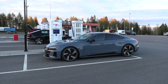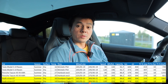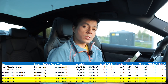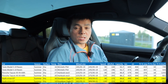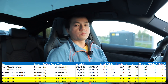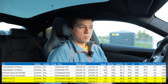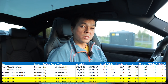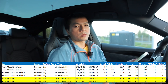We are back again charging, and the result for this time is that — actually to my big surprise — we only consumed 224 Wh/km, with an average of 14 degrees. That means we have 378 kilometers of range, given that we also got 84.6 kWh. I didn't bother measuring it because I already tested Taycan many times and it's the same battery. So if we put smaller wheels on this car, we should be getting about the same range as Taycan. Model S has better range, but that was a test with 19-inch wheels, so if you put on 21-inch wheels on the Model S — actually it doesn't make sense to compare to a Performance Model S, because the Taycan and the e-tron GT are not the performance versions. Even then, Model S will have better range and lower consumption, but it's around there.